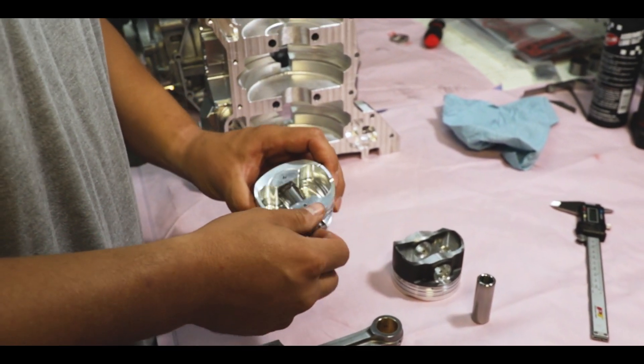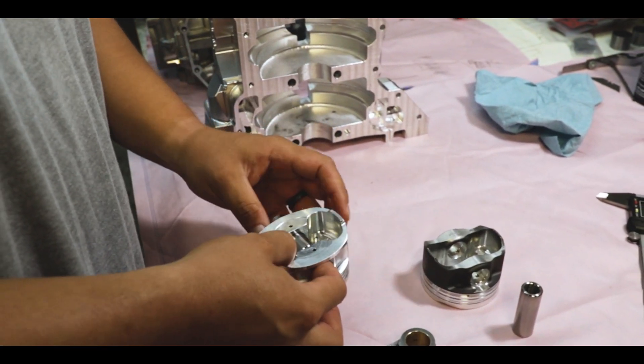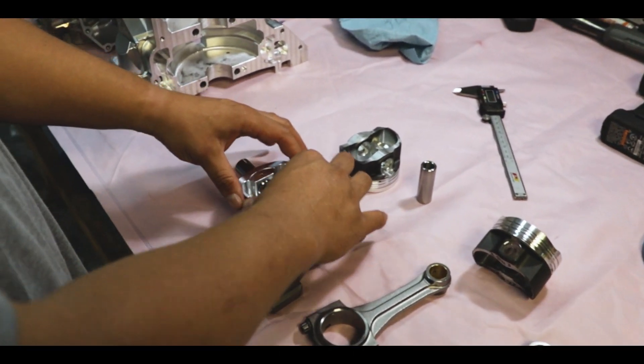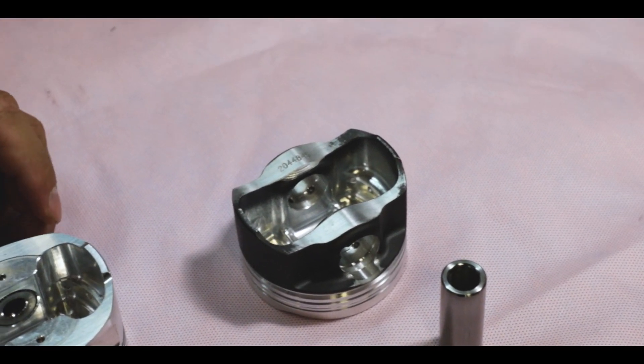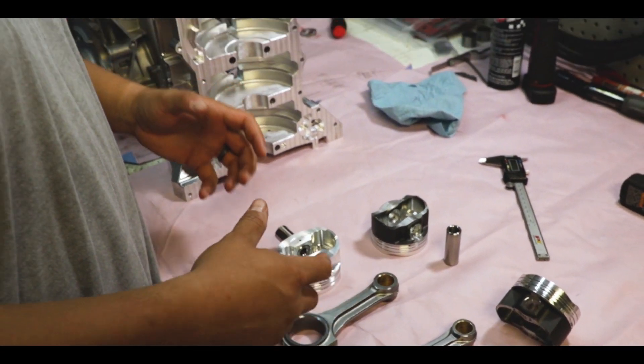It's still a 20 millimeter pin — it basically uses the same wrist pin in each of these designs. This one offers more strength because we have an extra skirt on the bottom to add a bunch of structure. The hardest part is when you add all this weight and strength, you need crankshafts where you can either add heavy metal or make the crank heavy enough to balance the setup. So Brian Crower — BC — is making us custom cranks.